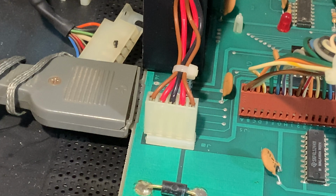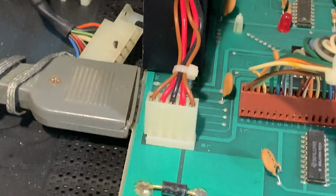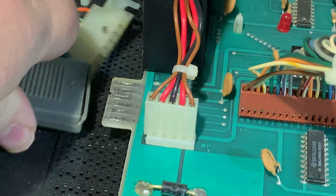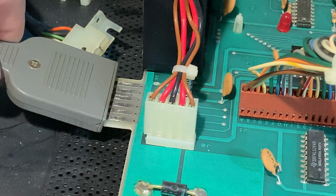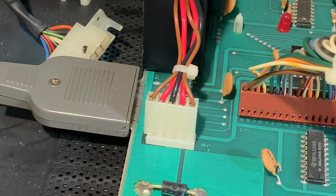So we're going to rewind, and we're going to press stop, and we're going to pop the tape and set this Datasette aside. And we're going to take the other one that we had used before. Nothing is pushed down. We'll plug it in. We'll take the same tape and put it in. Set the counter. It is rewound. We'll press Shift, Run/Stop. We'll press play. And see if anything comes up. Searching.